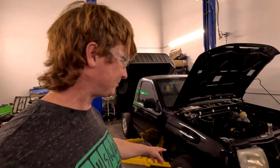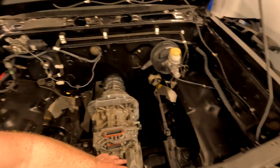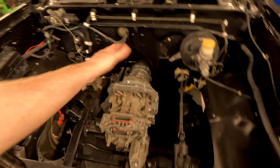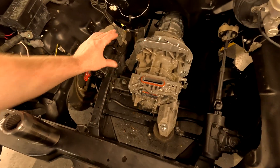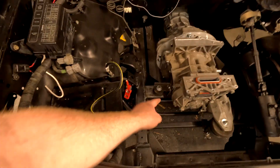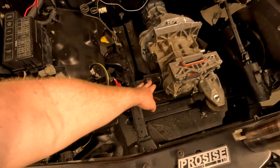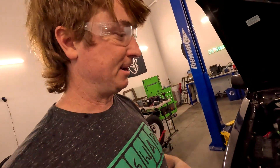Working on the Frontier, we now have the motor mounted into the chassis. We've got mounts on the front and the side, and a mount holding the transmission in the rear. When the motor is running it's going to torque counterclockwise when viewed from the front, so we need an outrigger brace on the passenger side to take that torque load — something I had to fabricate. I used three big M12 bolts into the casting, a nice piece of angled steel, and a rubberized motor mount from my Land Cruiser project that fit perfectly.